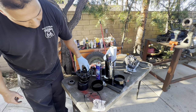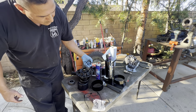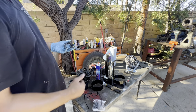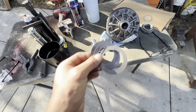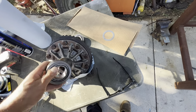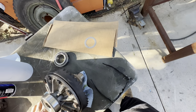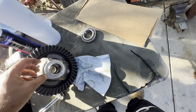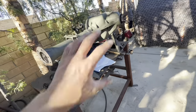This is the old one — better measure what they got here and use that on the new one, then go from there. Got my new spacers out, measured 45, and the old ones are mangled. Got my setup bearings ready. Measured 15 on this side. Setup bearings ready to go — going to turn this around right now.